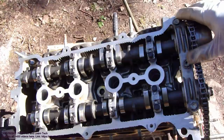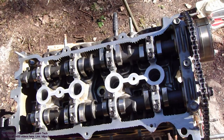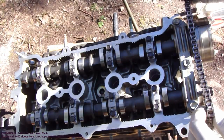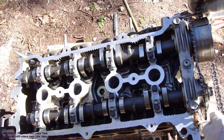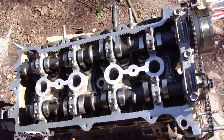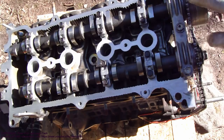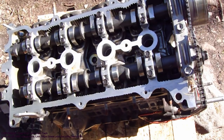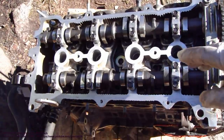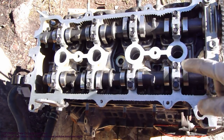I saw this timing chain assembly and setup really carefully, because there are many things to do. Okay, the first thing we need to check: I set up this timing chain in these bolts so that it is released, that it is not yet in this sprocket teeth in there. And first step, we need to check now that this is the number one piston.